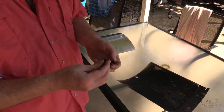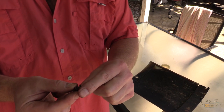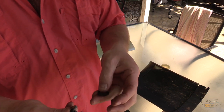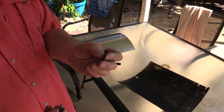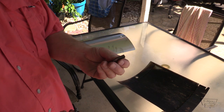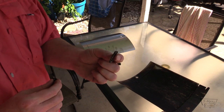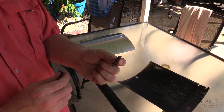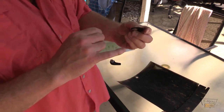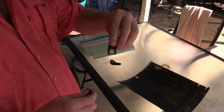Okay. So again, you got the metal screw, a regular washer, and then a lock washer on there also. And then this is the piece that goes on the inside. What you want to make sure is that when you put this back on, these little curved edges flare towards the inside edge of your Weber Smokey Mountain, towards the charcoal, into the middle. If you notice, it's got a little square. It's not round right there, and that's where you get that locking part.